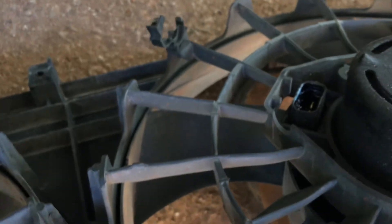Here's the fan assembly — that's what's in there. Down on the bottom of the fan are the two connections, one on each side, so you've got to pop those out. There's also a bracket that sits on top of the fan that you have to take off — it's really just one 10 millimeter bolt; you take that out and pop the bracket off. Like I said, it's not a hard job, it's just not a simple job. It's not as quick and easy as I thought it was going to be. I'm going to go ahead and take this off, pop the radiator loose from the condenser, and get it out so I can get the new one in.